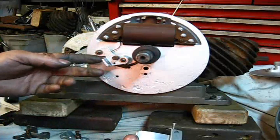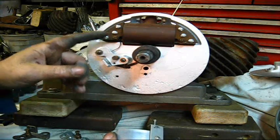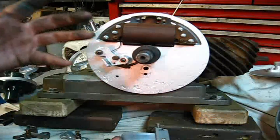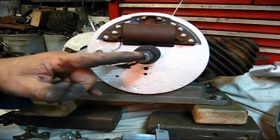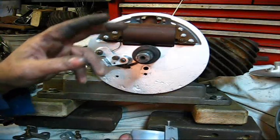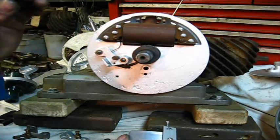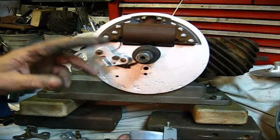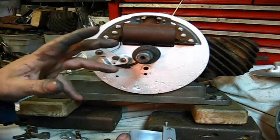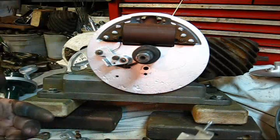The only thing about this method is that it just positions everything — it does not give you any leeway for adjusting the timing before or after dead center. And that's the reason for this whole set of videos: so you can make that timing adjustment to correspond with the RPM of the engine. To run your engine slow, you need to adjust your timing closer to top dead center, but not to the point where you're firing after the exhaust stroke causing overlap, which will cause excessive heating. You want to reach the point where timing corresponds to the RPM.